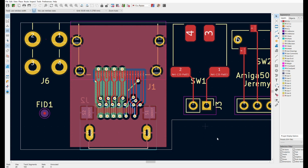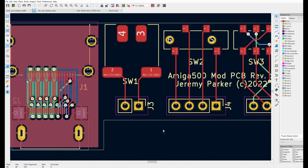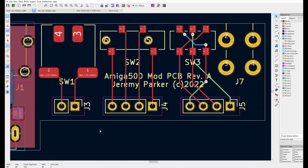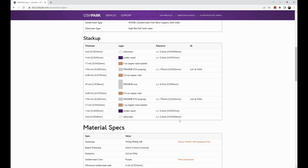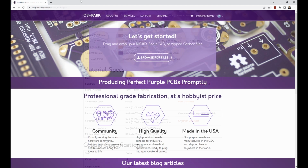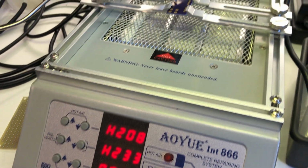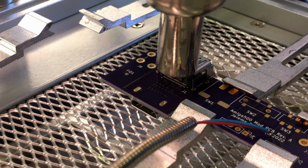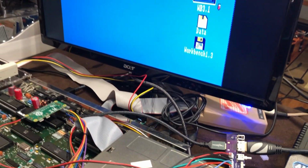Since HDMI requires a certain impedance between the differential pairs, I had to lay out the PCB using a microstrip design and a specific PCB stack-up in mind. I will link in the description to all the PCB info and design files in case you'd like to make your own. I used OSH Park and their standard 4-layer PCB, so you should be able to order from them using the zipped up Gerber files. I received back the PCBs, populated them, and they worked.